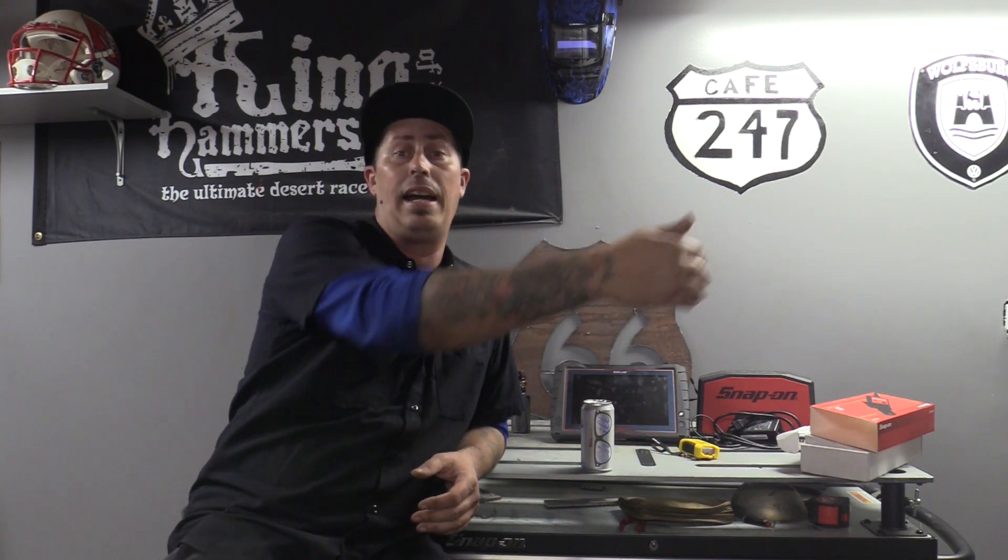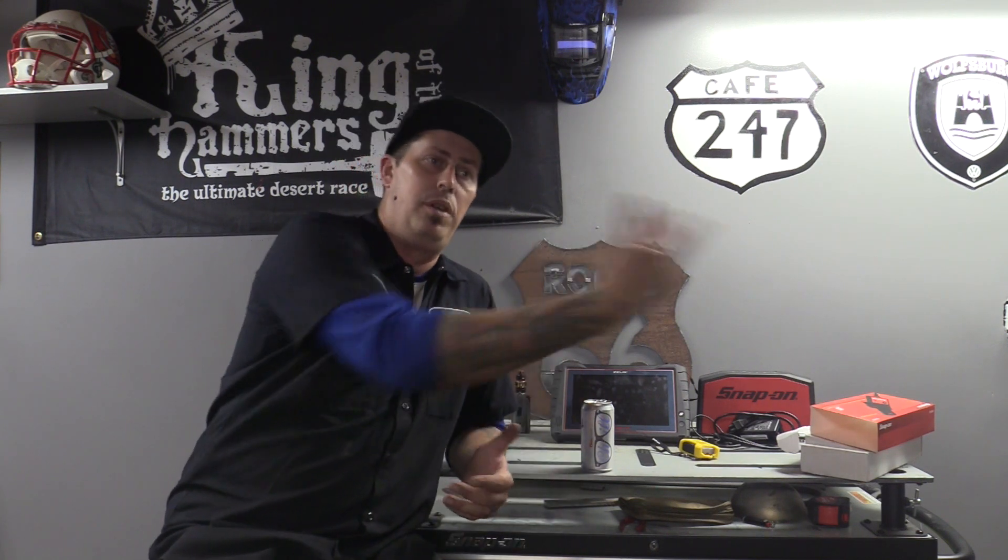My buddy Nathan from Polly's Auto and I have been talking back and forth. One of the things I was diagnosing this past week was on a Ford 6.0L — there were issues with compression, or lack thereof, in cylinder number one. I found that out while going through a buzz test and a cylinder contribution test trying to diagnose a dead miss. He mentioned that a pressure transducer could help and that you can actually adapt it to do a compression test on a scope, which I haven't tried before.